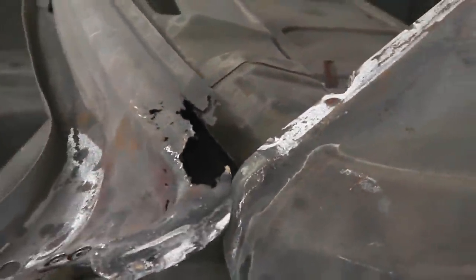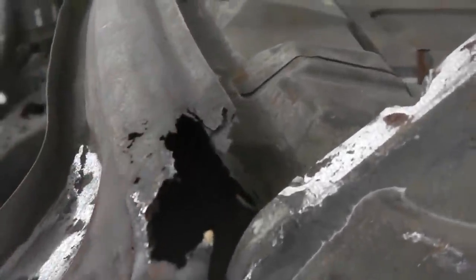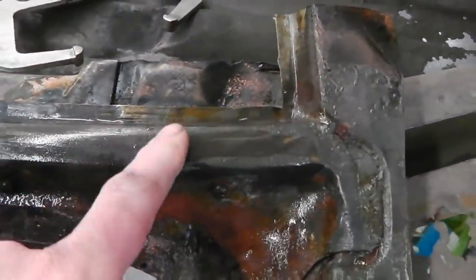That takes us across to this repair that we need to do before the wing goes back on, while we're waiting for the chassis leg to arrive from the dippers, which is next week, I've been reliably informed. Some repair to do here. Again, the same shell that's just offered that B-pillar offered this piece, so I burned the paint off it and dropped it in the acid tank for a few days just to see what comes up, and it's the piece that I need. Indeed, it is exactly what we need for there. So we can cut out and drill out just a section that's going to fix this.